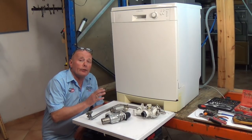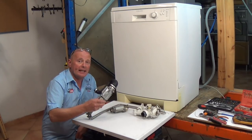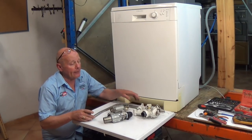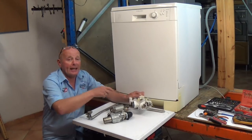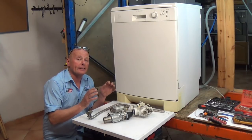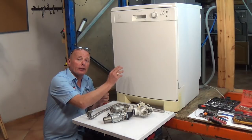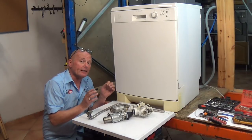These are all possibilities that the heating system or one of the thermostats in the heating system may be failing. This dishwasher runs on a flow-through heater. A lot of other dishwashers use elements inside the compartment itself which are visible, and some have elements built into plastic systems which can be unclipped and tested with separate thermostats and NTC sensors. All models of dishwasher vary, so it's very important to understand what heating system is in your machine before you start any work. You can find this by getting your model number and PCN or serial number.